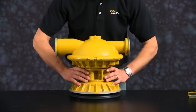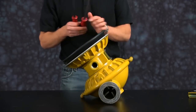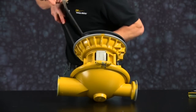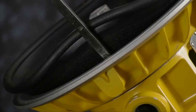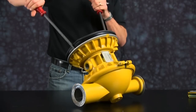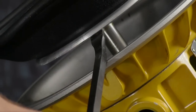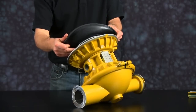Now we will install the opposite outer chamber. For ease of installation, we are using two 12-inch pry bars to get up underneath the inner diaphragm plate to shift the diaphragm assembly across. Be sure to align the pry bar up underneath the inner diaphragm plate so we do not damage the diaphragm. Gently pry it across. Once it has been shifted across, you can roll the diaphragm seating the outer bead into the air chamber.